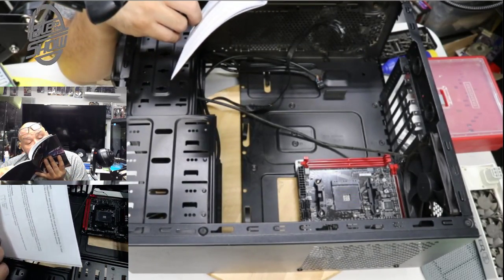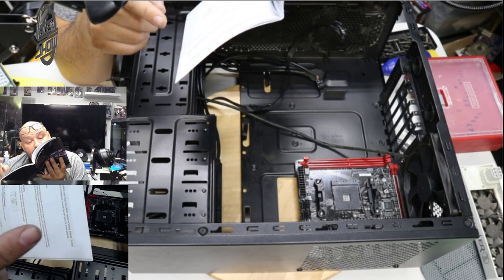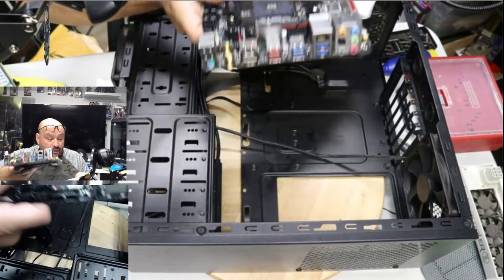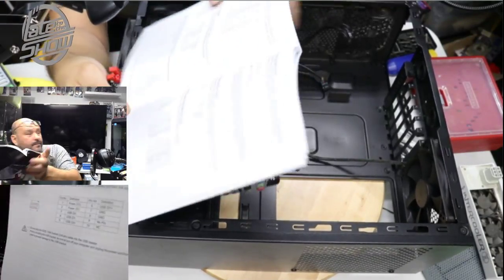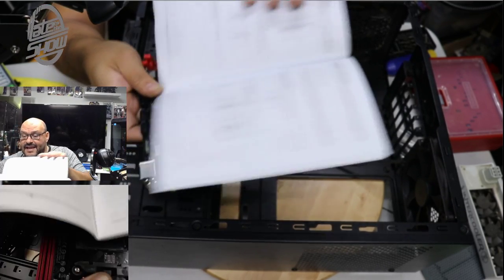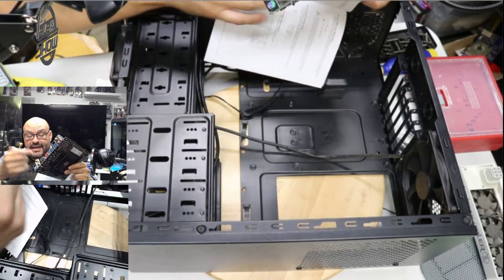That means power 1 is the 6 pin. We have to go to the 6 pin for the power. Number 2, power 7. So 6 and 7 have to be taken by the power, right? So you have to start from one end to the other. What you have to do is find the location and point out exactly where number 1 and number 2 are. Right now, let me see if I can put the manual here. The manual's telling you that the last pin that's missing should be number 9, and 10 is the top one. So if your motherboard tells you the 9 pin, it should be this way, which is the 9 pin there, and it should be going that way.